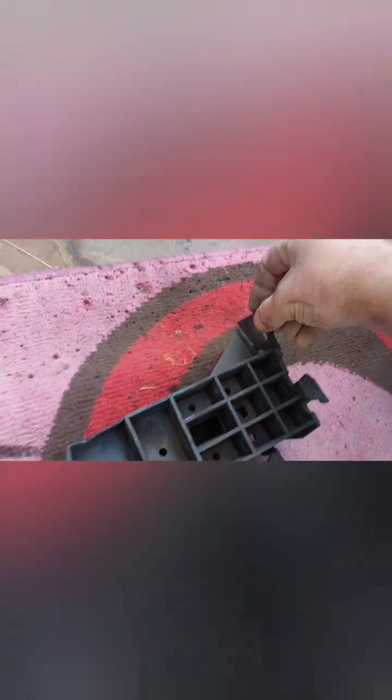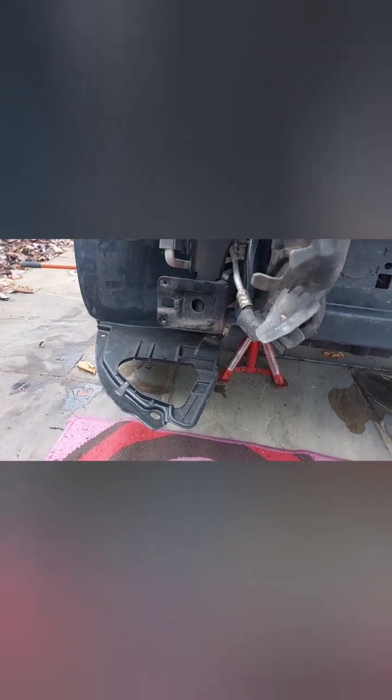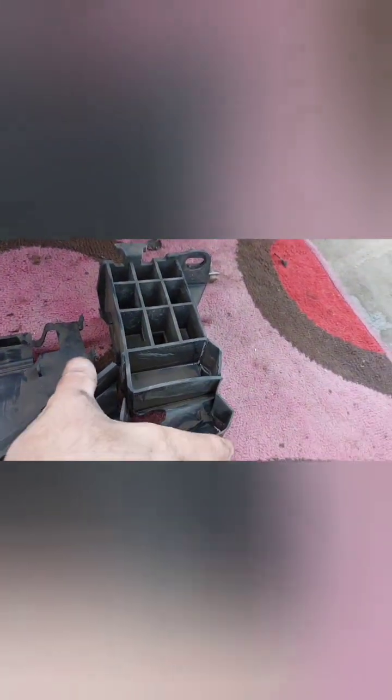I think I need to warm up this section here, try to straighten up this piece that goes in there. I'll try to epoxy glue this section here. Hopefully it's gonna be man enough. You can always make a bracket across between this section and that section there. Okay, and for here, that part there didn't break, but everything else around it broke, so I might be able to strap this somehow, and some plate straps or something.